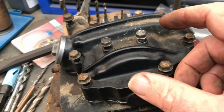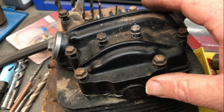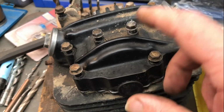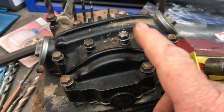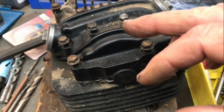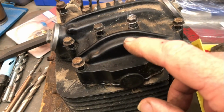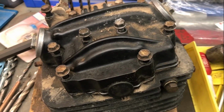The camshafts were out as well, and I just picked up one of the two camshafts and dropped it in here with a sprocket, just to have this cylinder head complete. And looking back at this one, this camshaft has got scoring on the journals where the other head is damaged, and so I've used the best camshaft by chance to get the other engine going. I didn't show it, but I used a little bit of fine emery paper in the aluminium journals on the head that I'm running, where there was scoring, and it knocked some of the high spots off, and we'll see how that goes.